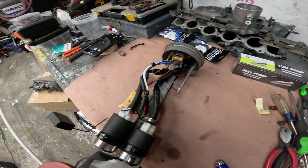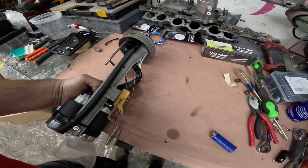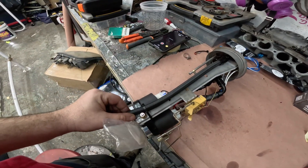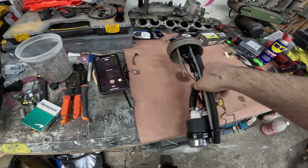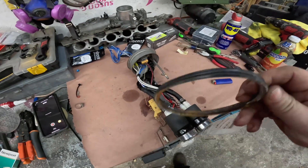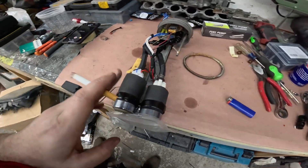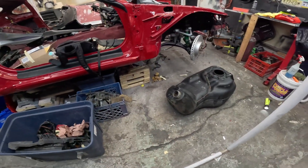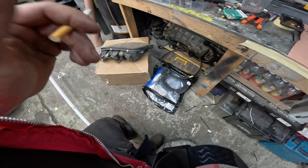I got a dash-8 that's going to feed straight into the rail, and two dash-6 lines coming from the pumps. I've got bags over the boots because I can't put this in yet. On this side I just got the dash-6 return with a wire tie right between the pumps. I test-fit it and it does fit — goes in very snugly. Once this o-ring comes in — the o-ring that seals the entire hanger to the tank — I'll be able to throw this in the tank and get the tank into the car.